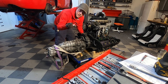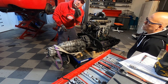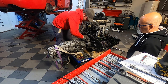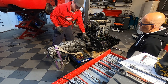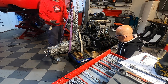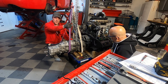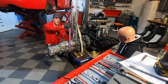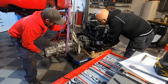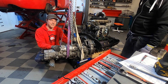So that's the clutch shaft. And with that, the clutch fork is loose. We try to provide a little bit of strain on these here just to unload it a little bit. Once we have that, we'll just loosen the last little bolt — this is finger-tight here. At some point we should be able to just pull this out. Very good. So this is the first piece of the C4 out.